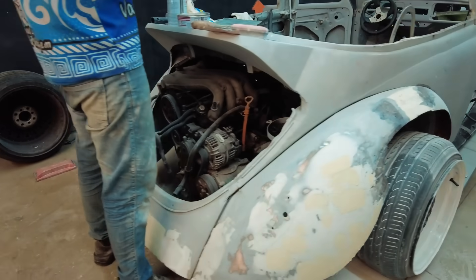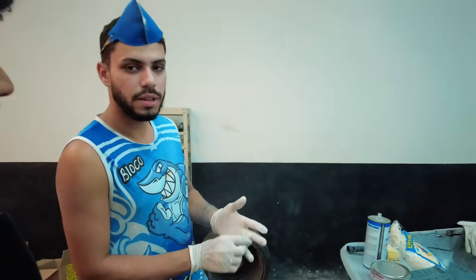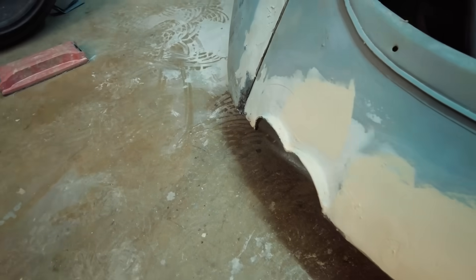Making all the rear and lining it up — it was well aligned because we took a very old Fusca, right Luquin? Kind of beaten up. Yeah, and the body was too thick, so everything is coming into place. Even the detail here of the gap — look, it's beautiful. Now Luquin passes the first plastic mass to align everything, and then comes the thin polyester on top, removing all the holes. So it's cool.